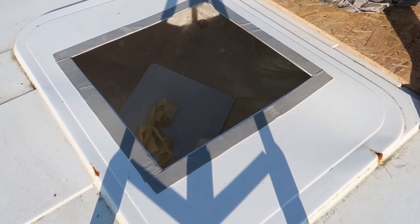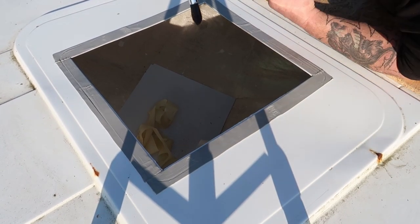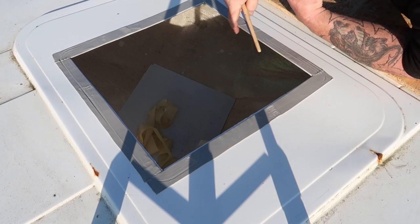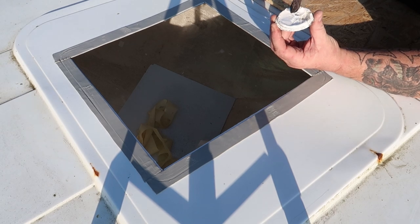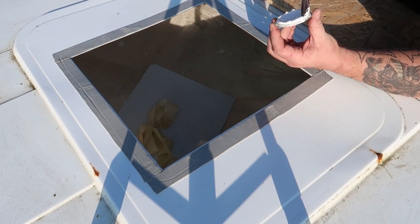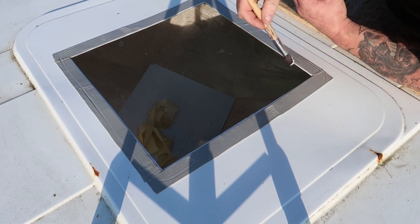That's the mastic tape on. Before we put the vent in, obviously we've got bare metal showing around these edges. So a good practice is to put a touch of paint on. I use a small tin of white Hammerite paint, and I just touch up around those edges.